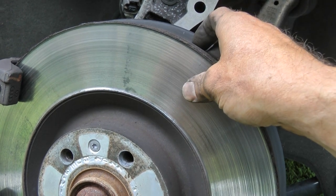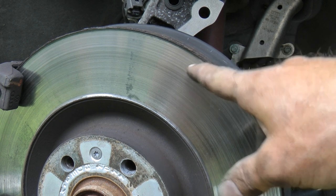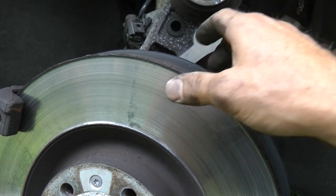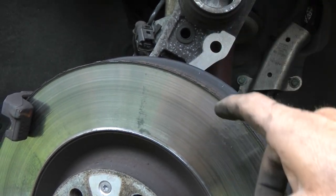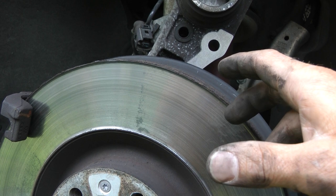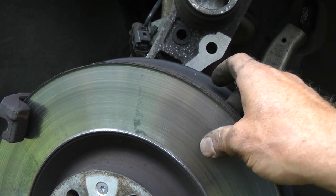What does make sense to me is that the people that sell disc rotors and the people that install disc rotors are always going to tell you that you need to replace these — because they make money on it. I'm going to leave it in place and we'll see how it goes. The directions on my brake pad say to sand off the residue with 130 grit sandpaper, which I'm going to do, and my guess is it's going to work just fine.